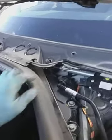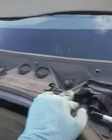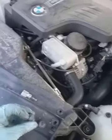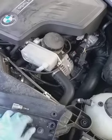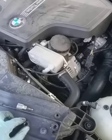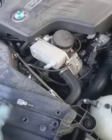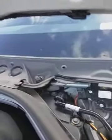Okay, so like I said, I'm halfway through this. I already got a newer used one installed. It's not broken. So you got to remove the wiper arms first. There's a plastic cap. These jokers right here. You just pull those off on the wiper arm, and here you will expose a 16 millimeter bolt. So you just take a pair of pliers, pull this off. You'll expose the bolt. Just pull them off. They're real easy and don't require too much torque.